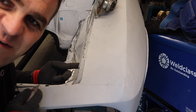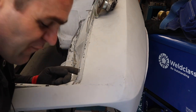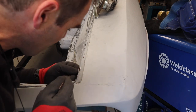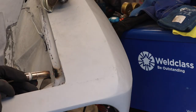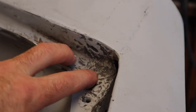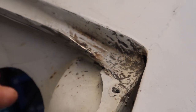As always, my finger through here — there's a hole, another hole I have to fill. There's always more welding to do even though I'm down to the painting stage. I missed it before, so I'm going to cut out a little piece, stick it behind there, draw through with a texta, then get in there and weld it in to patch up that little hole. This corner is quite nasty because it was completely mangled and I had to reshape it all and make it from scratch. Now the hole is filled, it's time to get ready for cleaning up and doing some body filler.